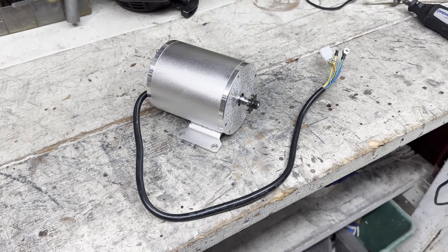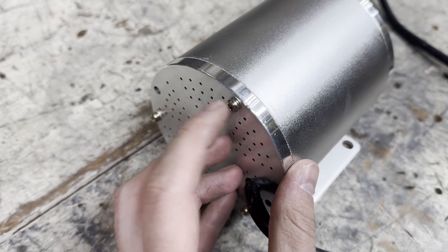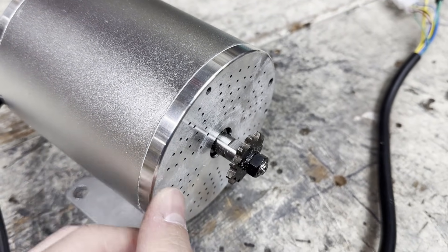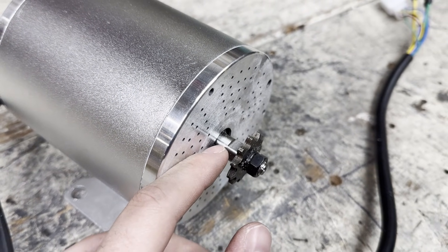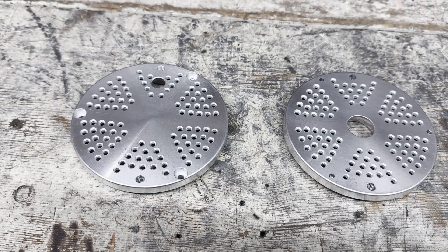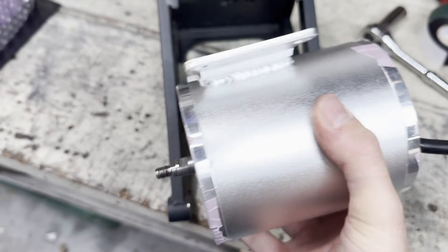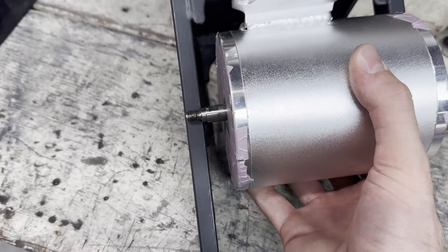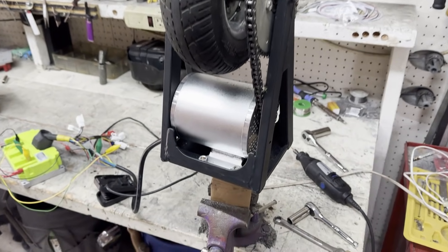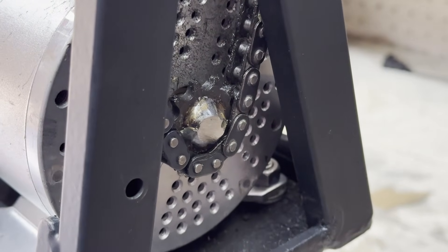I'm going to be using this slightly shorter 1000-watt 36-volt MY1020 motor. The first thing I want to do is take it all apart so I can drill the screw holes to make them flush with the back plate, and drill all the cooling holes to make them larger. I'll also have to relocate the sprocket. Here are the front and back plates with the larger cooling holes and recessed screw holes. Now that the motor is as compact and high performance as possible, it's time to install it. However, it's still too long, so I have to cut the shaft down. After cutting the shaft and welding the sprocket on, it was good to go. I bolted it down on top of two layers of washers to make sure it had some chain adjustability.